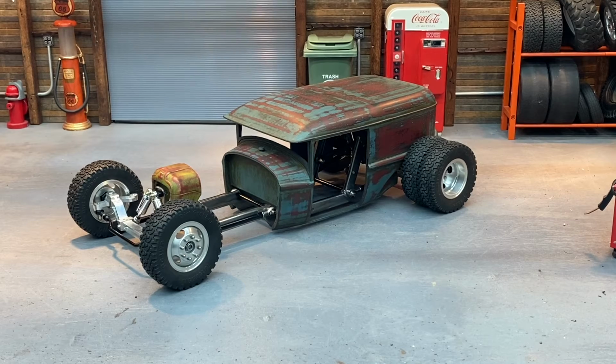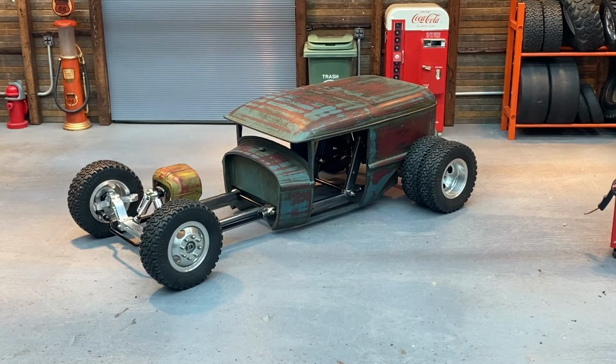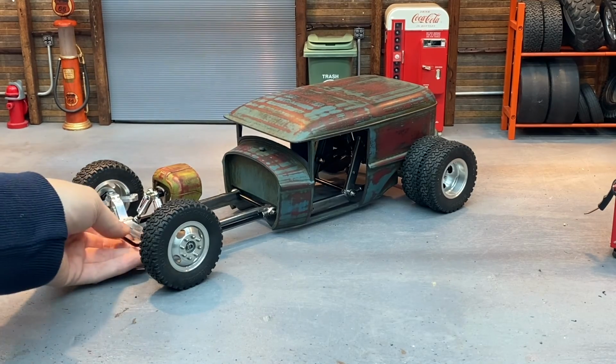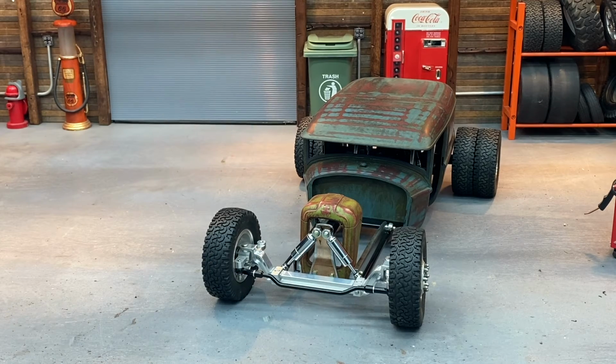All right, guys, so it'll work. It didn't work out as amazing as I'd hoped, but it'll work. It'll get us through the event, and we have a little bit of front suspension. Yeah, it's a little flimsy. So our main piece we put down there, we need another layer on that at least, something to stiffen that up, and I mean, we'd have to double it over at least with the bends that go into the C-channel and everything to get it to be rigid enough.